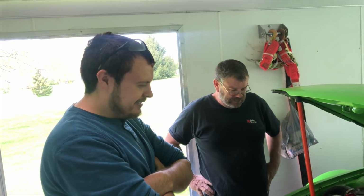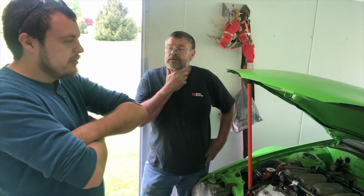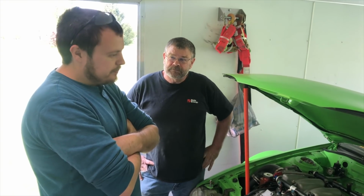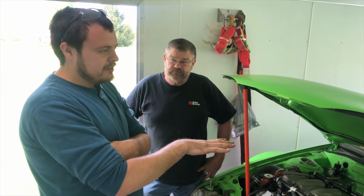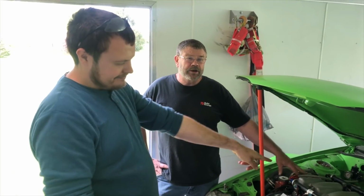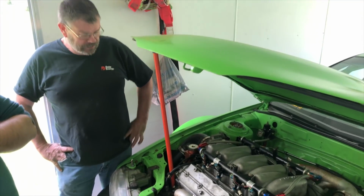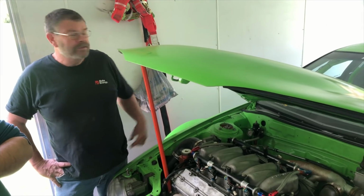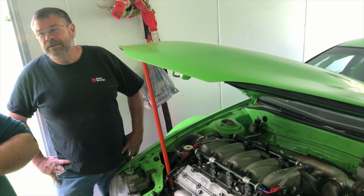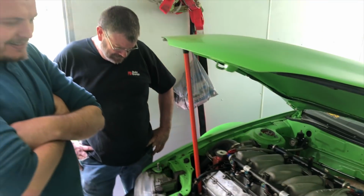That's my advice. Aaron Mello has developed a very neat way to do torque management with the Terminator X, so we're probably going to try that initially. We still want to take it to the challenge, so we need to change the ECU no matter what. So, intake's going back, ECU's going back. We're going to put an alternator on it. It was 16 volt. We made our own 16 volt battery for the car, and that took a dump recently. It kind of sat over the winter and we forgot about it.